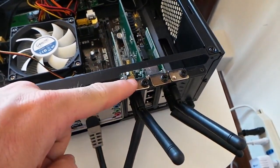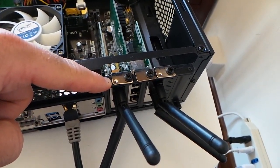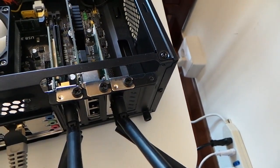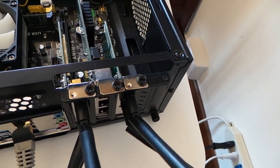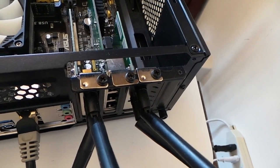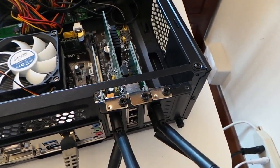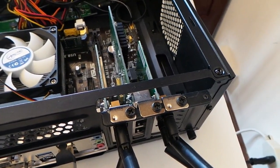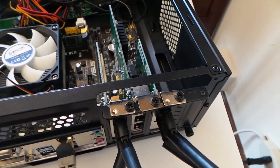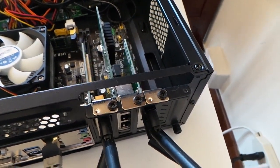Also, I could have just used one of these two wireless cards and used a VLAN, but the process would have been a bit long, so I decided to buy two separate cards, because the older legacy card was about 10 to 15 euros on Amazon.it, so it was very cheap. This card was 30 to 35 euros, so not really a lot. The LAN card, however, was more than 70 euros, because it had 4 ports. So if you want to get a used card or a 2-port only card, you can do it as well and save a bit of money. It depends on how many devices you want to connect physically to your network.